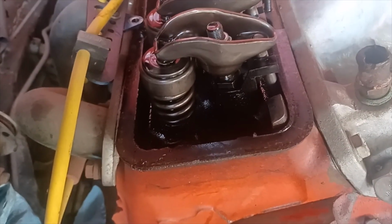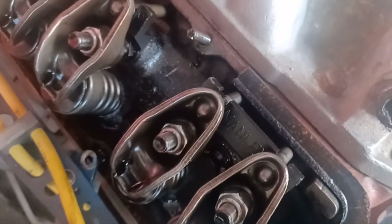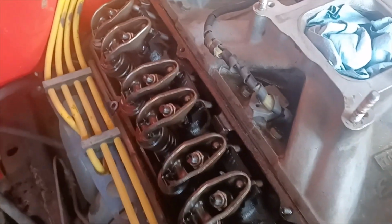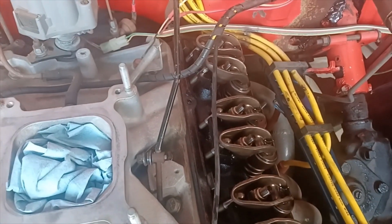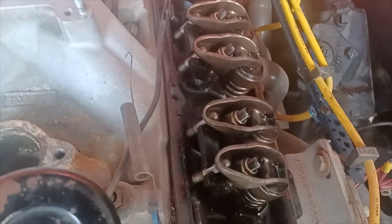We ended up having screw-in studs, so they took the stud bosses down, and I ended up going with a Manley composite guide plate. I don't know if I'd call it a cheaper way to put guide plates in it, but I know they've worked well. I know I've run the car in the past. I've run it all the way up to 7,200 in the past, and everything did fine.